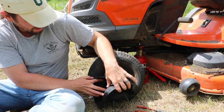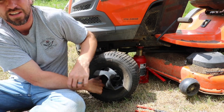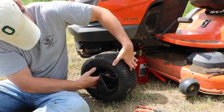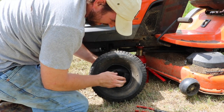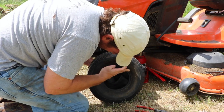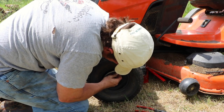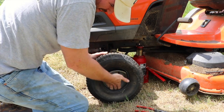Kind of fit it in and work it around the rim. We don't need to take the entire tire off this rim — it's just making it more of a pain. Our objective is just to pull this in and get it into place. Now we've got it inside the tire, and I'm stretching it around the rim. I need to make sure that my valve stem is in the proper location, because once it stretches around that metal rim, it's going to be harder to swivel and rotate.